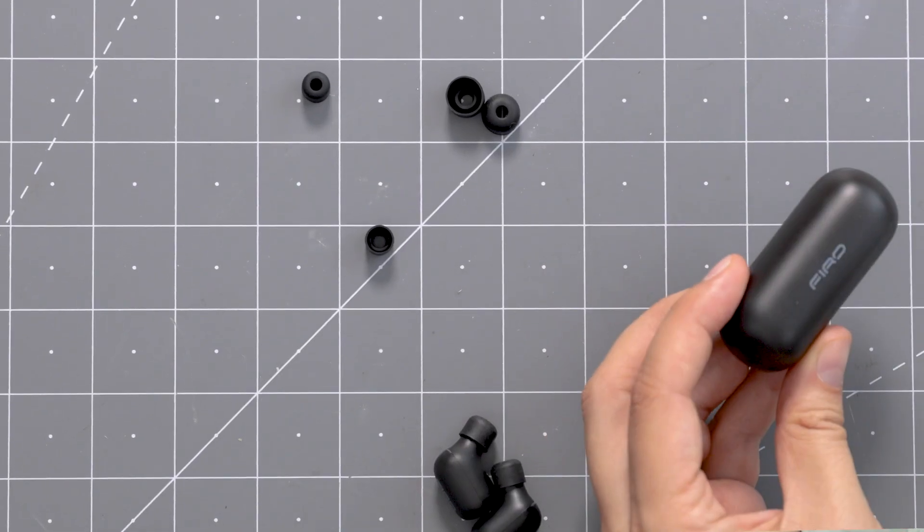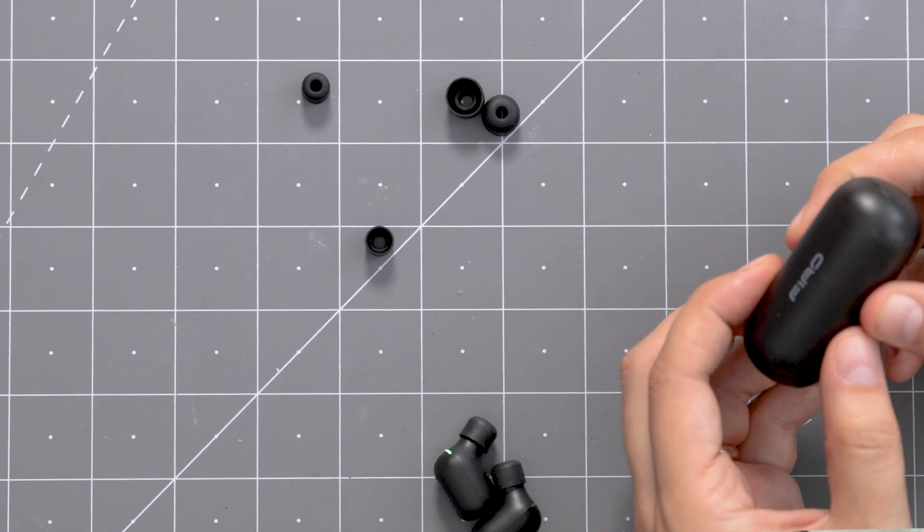One kind of amazing thing about the AirPods is that they use a really nice metal bezel on the bottom as the contact point to initiate charging. These, on the other hand, are using pogo pins that are clearly on the base. I found that they don't seat very well all the time — I opened it once and noticed one wasn't connected. You have to jiggle it around until you get the light. That's really hard when you're using pogo pins and magnets. If I were to give design advice, I'd build in a rib into the roof and put a secondary large magnet or latch so that when it closes, it shoves them onto those pins.